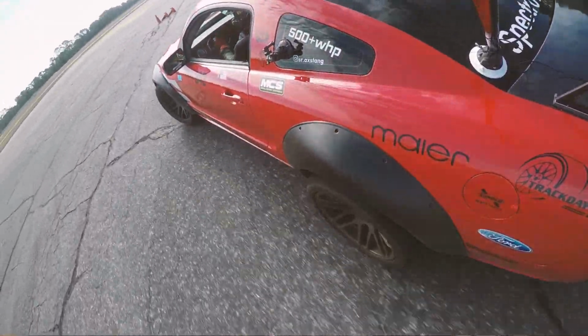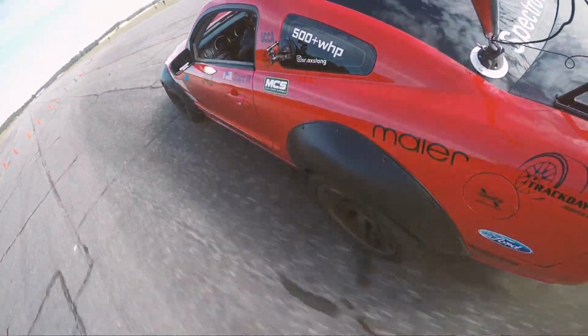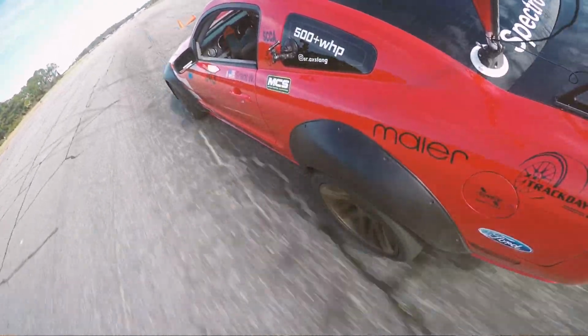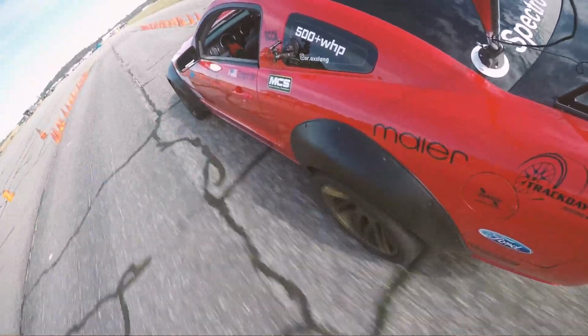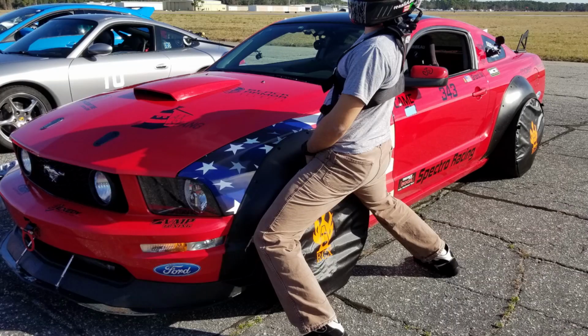Unfortunately, you really need a pit crew to use them. What would happen is I'd come back from a run, put the tire blankets on, they would hold the tire temperature in the high 90s, low 100s. And when I'd see 3 cars to go, I'd take them off, get in the car, get buckled in, and then I'd wait, go up to the starting line, and by that time the tires got cold. So what you really need is a pit crew or significant other to help you out, so you can take those tire covers off right when you're pulling up to the starting line.